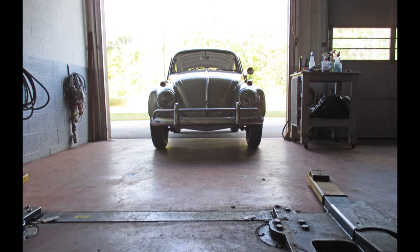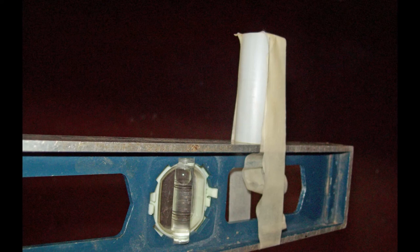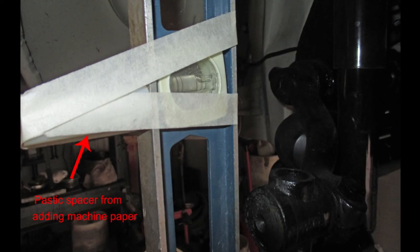The top of the tires were tilted out at the top, in on the bottom. Using my level and some homemade spacers that wouldn't scratch the wheel, I confirmed that. I lowered the car and put the full weight of the car on the wheels to see if it made a difference in this reading, and it really didn't seem to. But on an American car like my Corvette, the weight has to be on the wheels - you can't line it up, it changes too much.